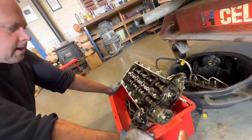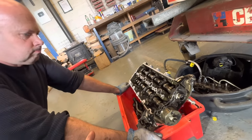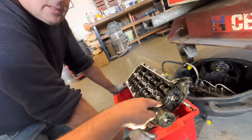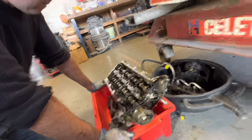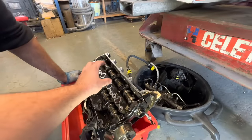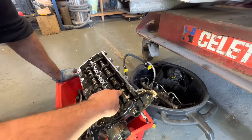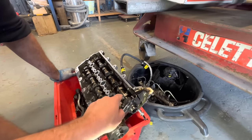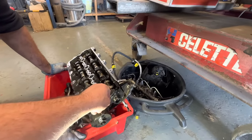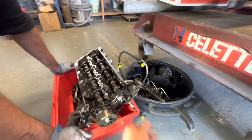It was so minimal on the Berlingo van we did, and people said in the first video, do you remember, they said they don't bend, that's a solid pole, and you put it in the vice and showed that they bend. This is not a cut piece of metal, that's cast. These are actually pressed on a hollow tube, so they're pressed on there tight so that the engine runs, but any hard impact on them and them lobes will move. So yeah, we'll do what you just said then, mate.